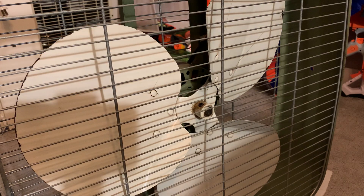Some of you might think that's really annoying — all that shaking and sounds. Here's what it is. You might think, oh, it's probably the blades causing it. I did some checking and took a very close look. The blades are not the cause of that shaking at the end when you turn it off — it's the motor. There's some play in there. I haven't taken the motor apart. When I do, I'll probably make a video and explain why. When you turn it on, it shakes a little bit. When you turn it off, it shakes a little bit. Probably because all the magnets in there, when it's running at full speed, keep it still. But when it slows down, that's when things start to sway a little bit.